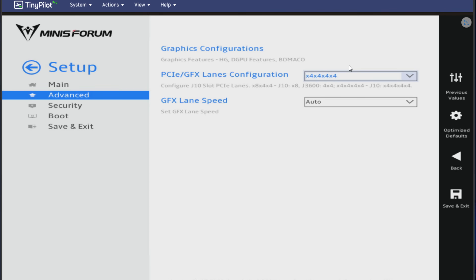I'll leave links in the description to those hardware modules in case you're interested. This is why I love this option, especially for a home server, as many Mini-ITX or Mini-ATX motherboards only have a single PCIe slot and you may be limited on M.2 slots. With bifurcation options and the right add-in modules, you can split these lanes and actually run multiple hardware components from that single PCIe slot — a really great configuration option on the Minisforum BD-795i SE.